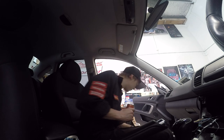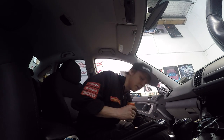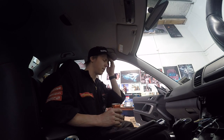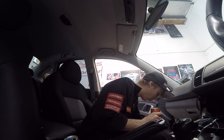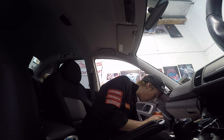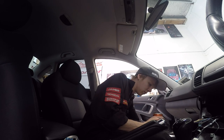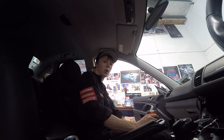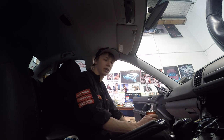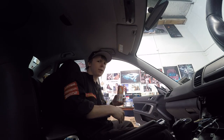Should I rock the seat back or not? Yeah, I'll rock the seat back. Tipping the seat backwards off its bolts just makes it a lot easier to work on the cables. I'm pretty sure these Subaru ones are always just passive with capacitors on the tweeters, which is good - so I don't have to worry about doing any capacitors. I'll tip the seat back, get down to the wiring, and show you guys what wires do what. Very simple.